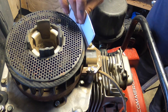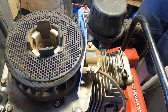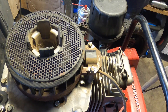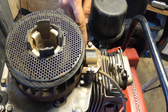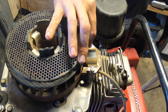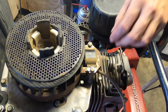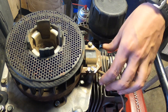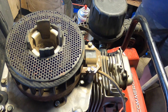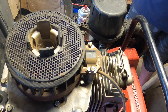I'm going to do the loose and easy way because not everyone, especially when they're in their garage, is going to have a feeler gauge for ten thousandths of an inch. But I'll go over how you're supposed to do that. Ideally you'd have two or one long one — you put it in between here. If you have two, you put one here and one here, then you move the magnet so the magnet is in between, and you'll literally see this gets sucked in. When you see that, you tighten these with your feeler gauges, move the flywheel out of position, remove the feeler gauge, and you're done.